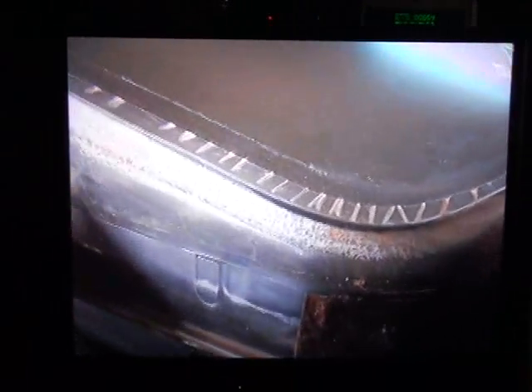The first step once the CRT is out is to remove the tape. It's like packaging tape on the edge of the CRT lens assembly. What we're going to do is take a razor blade and cut a strip on both sides about the thickness of the PVA material, which is about 3/16 to a quarter inch thick, and remove that tape. You can see how bad it is on this edge.